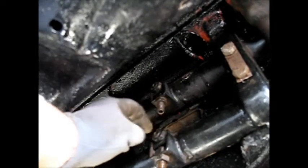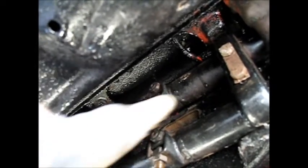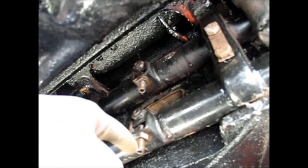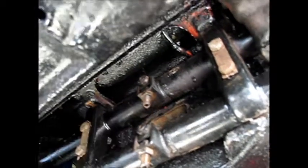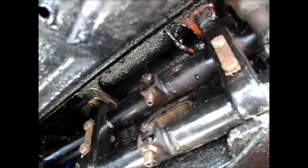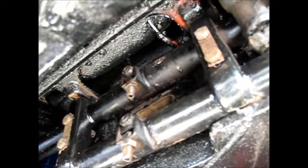What I think is that if I loosen this one, the front end is going to ride softer — which I want, because I want Honey Baby to have a nice soft ride. As an experiment, I loosened and backed off these adjusters; they were tightened up pretty tight. Backing them off dropped the front end way down low and stuck the tires right up inside the fenders. So that told me what this one is doing. I'm going to put that one back and back these others out.